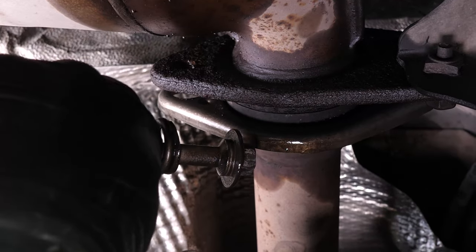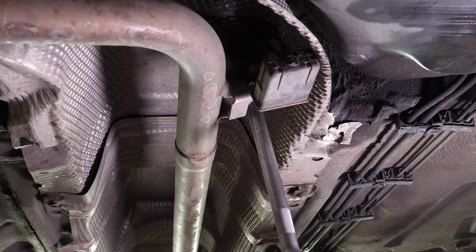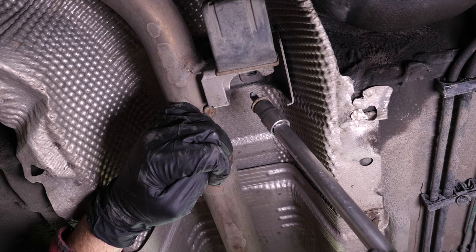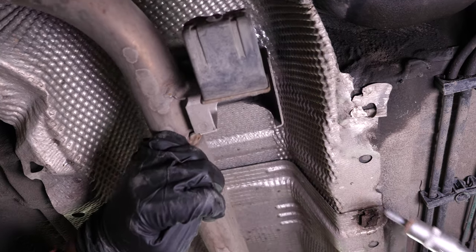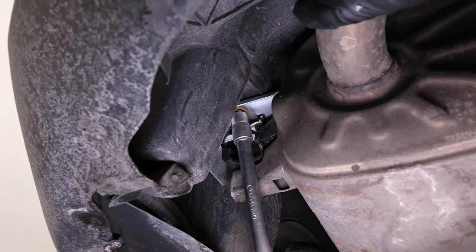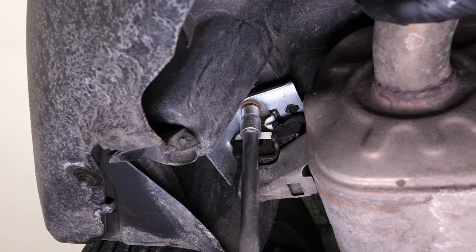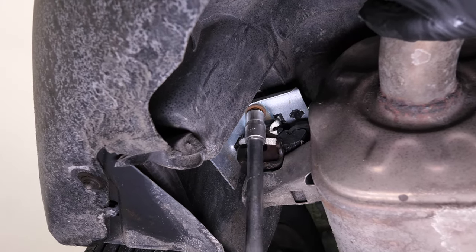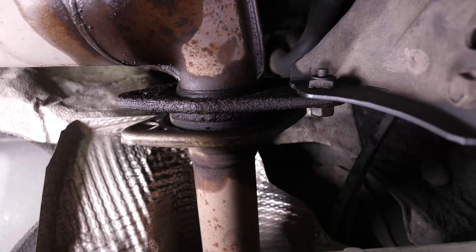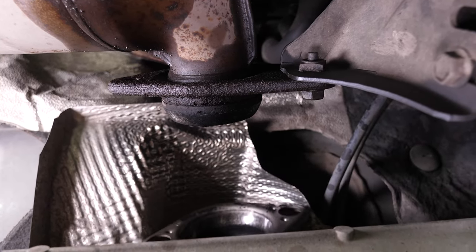Once the flange and the exhaust line is free, unscrew the suspension on the exhaust line on the side of the area that was cut using a socket wrench, an extender and a 13mm socket. Do the same thing with the suspension around the muffler. Once the two suspensions have been unscrewed, you will be able to move the line back, creating the space needed to remove the catalytic converter.